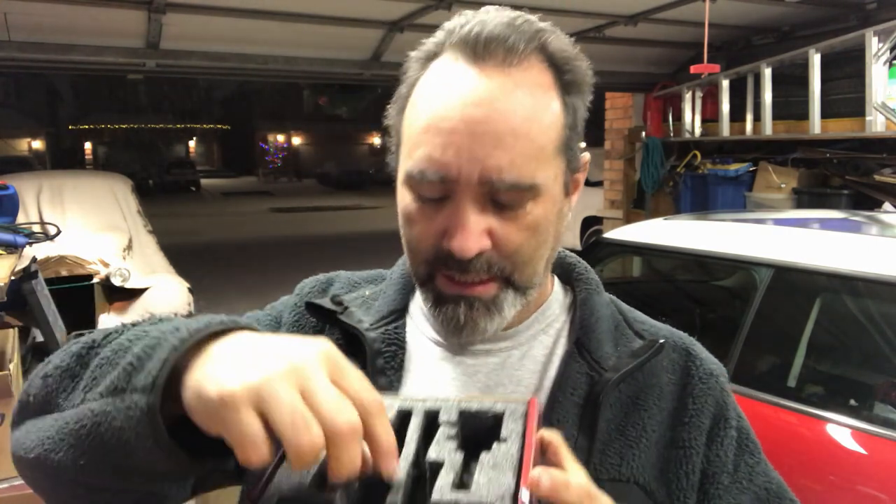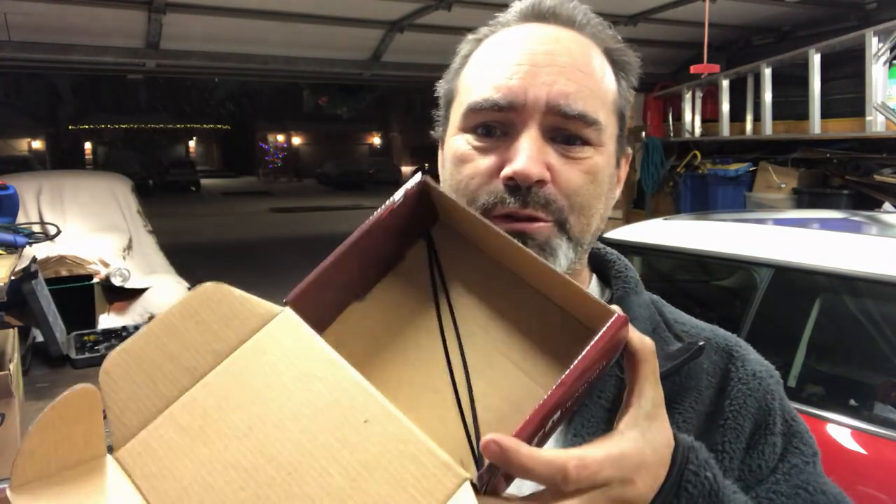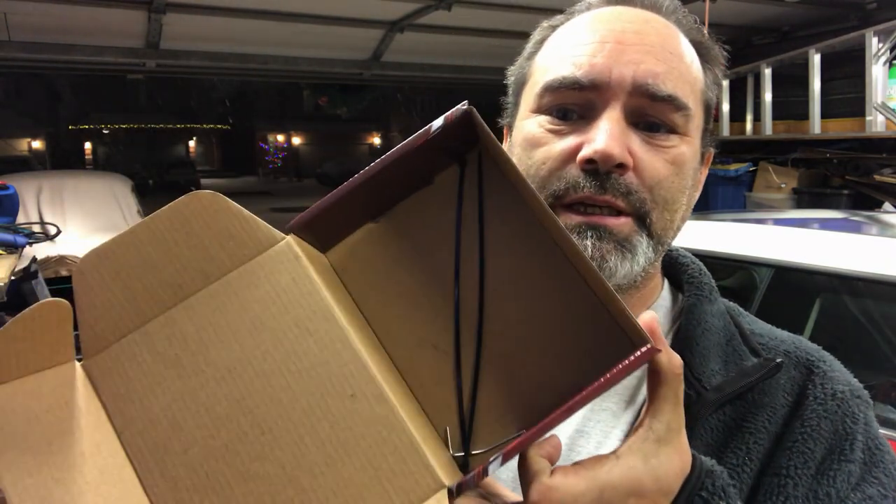Overall I have to say I'm quite impressed with this kit. It seems to work - time will tell how long it lasts. What I noticed - because I never look at instructions, especially Chinese ones - if you lift up the packaging, there are a couple of cable ties and a little Allen key in there. Presumably those bulbs are adjustable, so you can rotate them a little bit if the beam isn't perfect. That's especially important for the low beam bulbs so you don't blind people or have it pointing too far left or right.